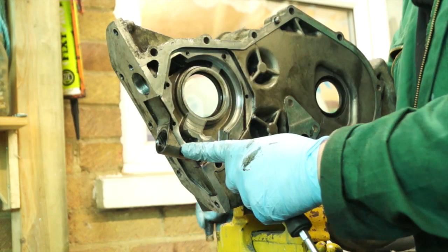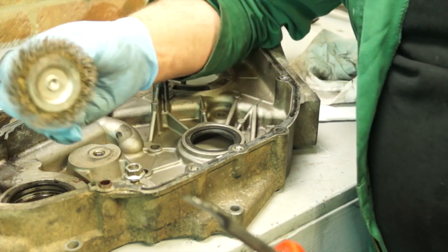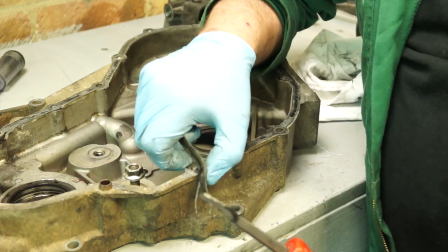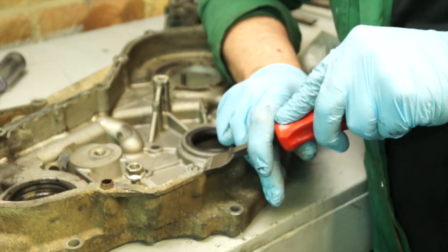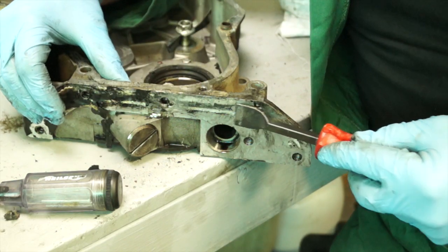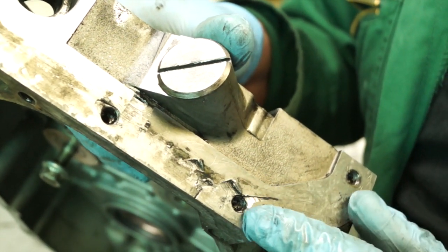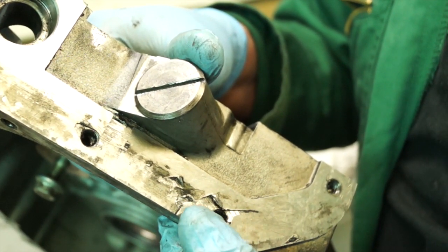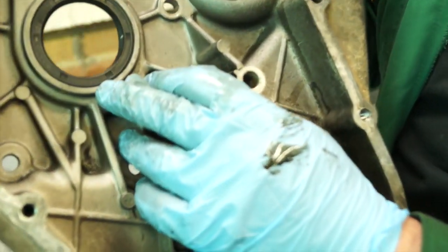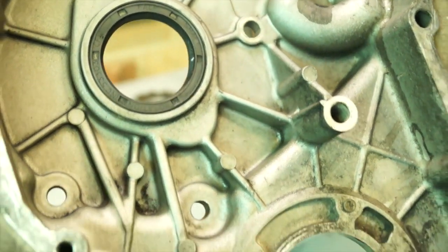For gasket scraping you can use a hob scraper with a sharp blade or a stiffer tool, and also a soft wire brush for getting the last bits of debris off. Whichever way you do it, do not damage the aluminium — just take it easy. Scrape all the gasket off front and back. On the bottom there's RTV silicone where the sump was glued on. The seals I'll leave in for now since I have the numbers here to tell me which seals to fit where — they can be removed last thing before refitting new seals.